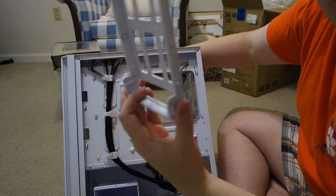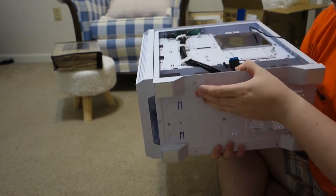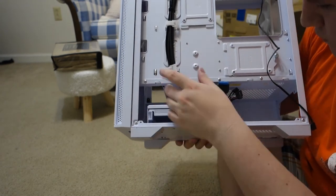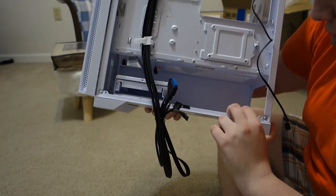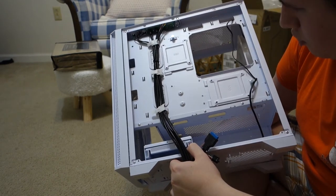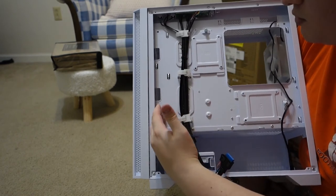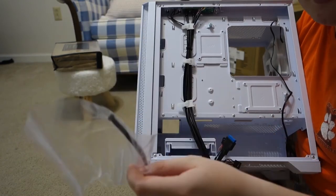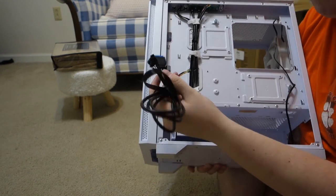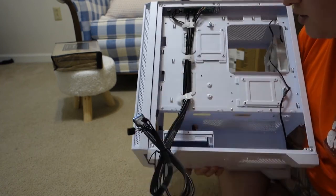About this hard drive cage: you put one drive in the sled, and up top there are little holes — this whole cage can come out because you have screws in the bottom. The whole cage comes out and you can put another hard drive up top, so you can fit two 3.5-inch hard drives in here. Obviously we have space for a full-size power supply. It's micro ATX so you're not going to be putting anything too crazy in here. There is a decent amount of room for cable management. Up here you have a little pathway to route your cables to the back, and you get some included zip ties to run through holes and tie your cables down. You've got Velcro keeping your I/O cables in place. We have your standard front panel connectors and you do get USB 3.0.